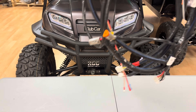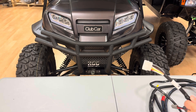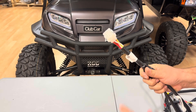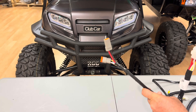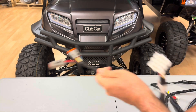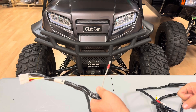Now we're going to go over the light harness for a Club Car Onward, non-HP. This is what we're going to have to put on this car now that we're converting the main harness to a non-HP harness — we're not going to run the body control module anymore. This is the plug that plugs into your IP harness for your lights. These two wires plug into the factory voltage reducer for your light kit; if you're not using a factory voltage reducer, you can cut these plugs off and integrate your aftermarket reducer into these wires. This little gray wire is the trigger wire we talked about earlier that triggers the brake light relay and the voltage reducer to turn on and off with the key — this plugs into the gray wire with the matching connector on the main harness.